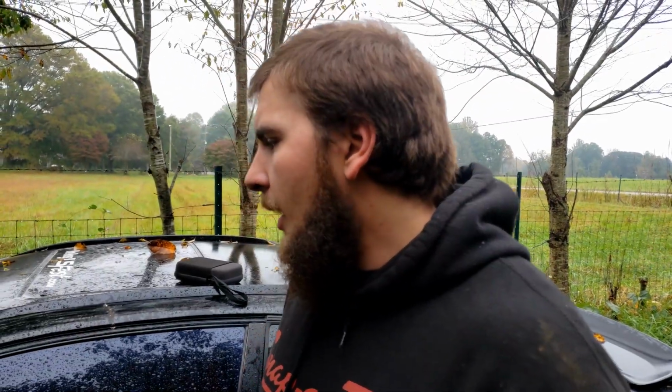But either way, I've been working on the tune, and that's going pretty good. The wideband is showing me pretty good air-fuel ratios, so I'm pretty happy with it. I can't really do much with the timing right now because I'm getting a little bit of knock on the top end, just because I think I have a valve seal problem, because you'll get a little bit of an oil smell when you really get into it. You have to keep in mind this engine is a junkyard engine out of an old Chevy truck, so it can have those types of issues.